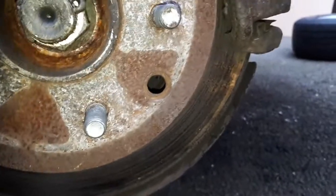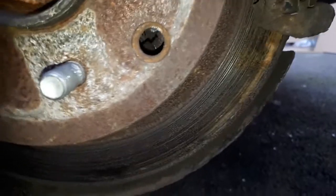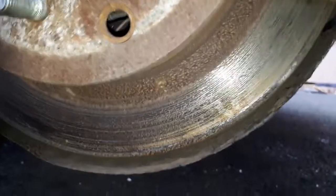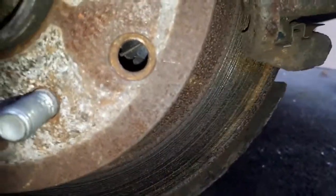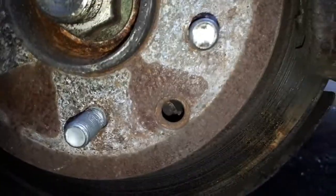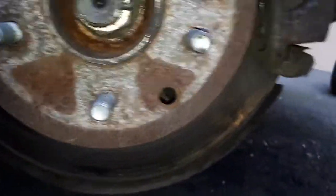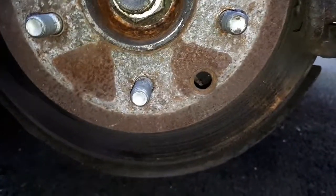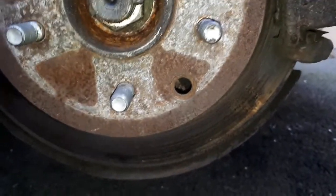The wheel holds on. That's your brake shoe in there — there's a spring if you can see. That's all it is. These two brake shoes are attached by the spring, with the adjuster in the middle. One spring at the bottom, one spring at the top. All you have to do is take these springs off and you can remove your shoes if you're changing them. Otherwise, use the adjuster wheel to adjust without stretching the brake cable inside, or if access from inside the cabin is difficult.